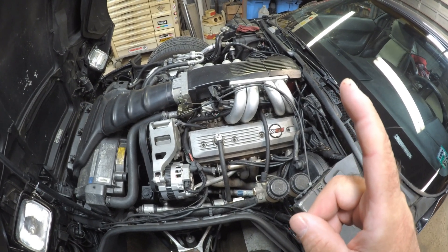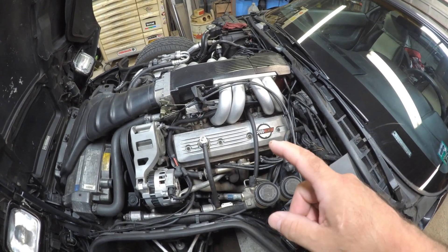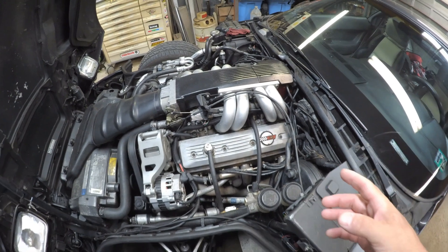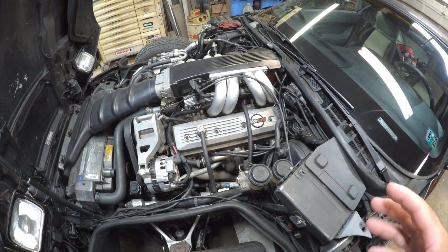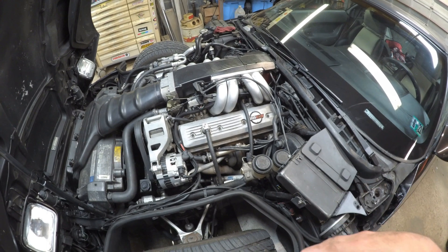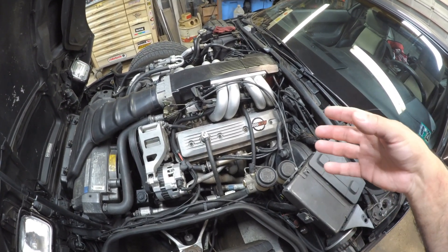Other people run a vacuum pump — I'll leave a link to the homemade one I made. I still consider a vacuum pump because one disadvantage to a PCV system, even though it draws fresh air and circulates it through the crankcase, by the time it gets here the valve is hot and so is that air circulating into your intake, so you're heating your intake charge more. And if you don't run some type of crankcase air-oil separator — which the stock system usually doesn't have — that oil is going into your intake. If it's really bad you're going to end up building up a lot of carbon on your pistons, and that can cause pre-ignition, not to mention the hotter intake air.